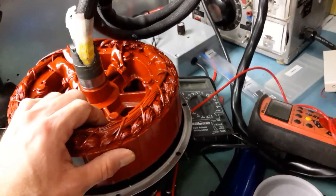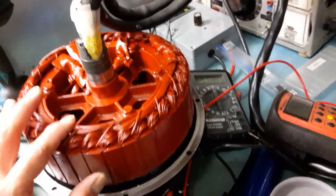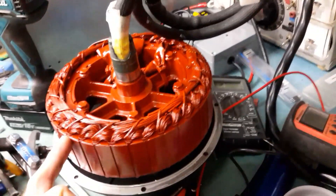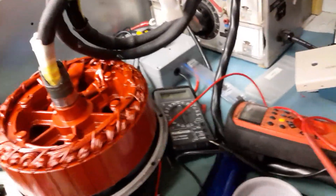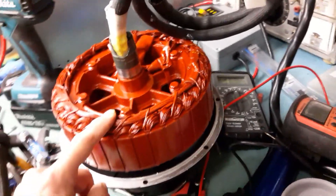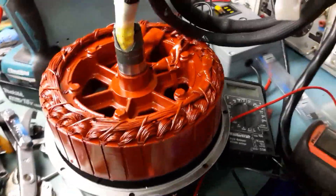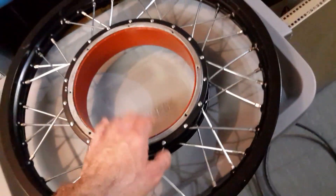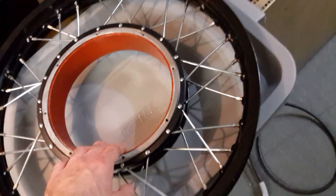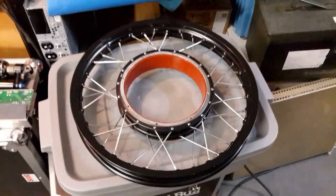When you apply paint, there's no problem baking it at about 100 degrees Celsius for the stator. But for the rotor, the magnets are more sensitive to temperature — they are more fragile when the stator is not closed to the magnet, because the open magnetic lines make the magnets more sensitive. I recommend a maximum of 60 degrees Celsius to bake the magnet ring, for about 12 hours, and that will harden the coating. Thanks for watching, guys — bye bye!